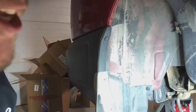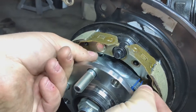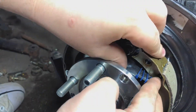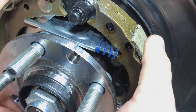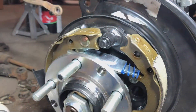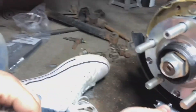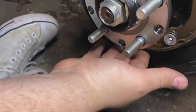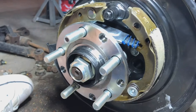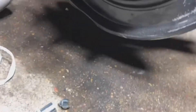All right, we had to fight that for a while — we're back. So we got this piece here, there's a little spring going out of it, it slides in like this, and this piece slides over that, and they key in right there. Hopefully when they're all compressed they find their homes — just like that. Now that's all sitting there. We got a star wheel adjuster going on the bottom — make sure you have that access hole behind there so you'll be able to get to the actual teeth on the star wheel adjuster.